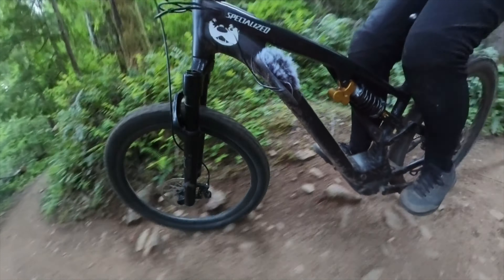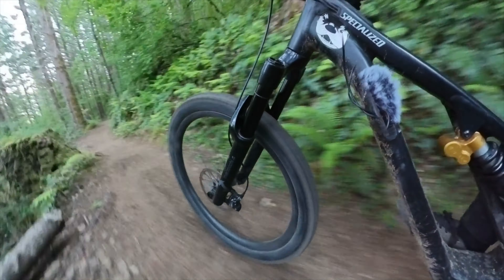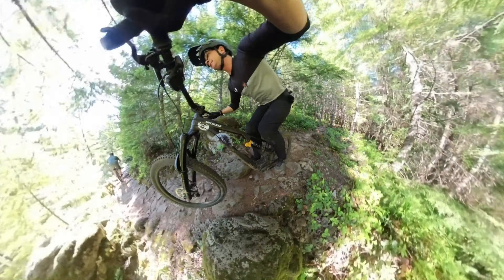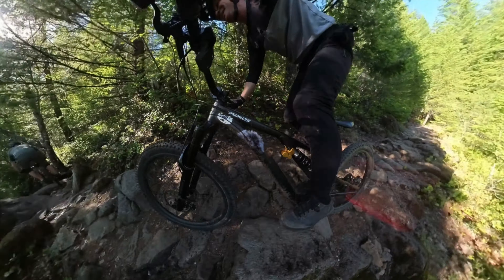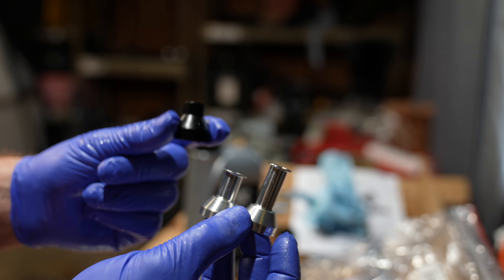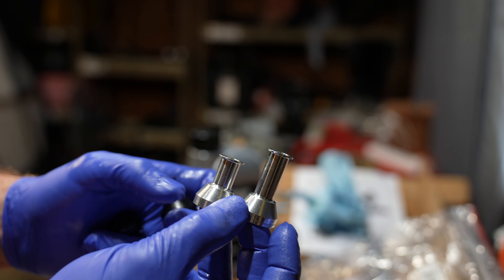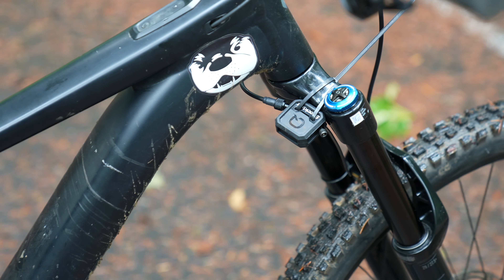I did a whole bunch of dyno testing on the bench and it looks like the two positive and negative air spring chambers are equalizing and the rebound is working as it should. The Marzocchi e-bike chassis rides really good with an upgraded damper. But the question is did that air spring actually help? The fork was kind of inconsistent — super challenging to set up, felt like it was changing all the time. It turned out it was leaking air because the second time I took the air spring apart I forgot to Loctite the foot nut. Taking it back out for a ride with the stock 36 Rhythm air spring, there was virtually no difference, so upgrading to those modern air springs will not help you.